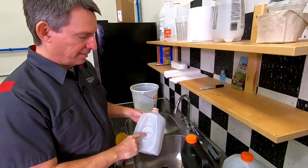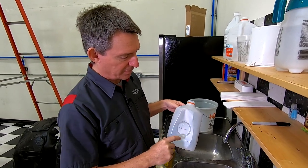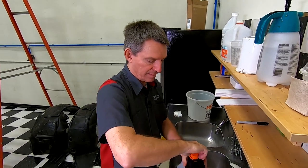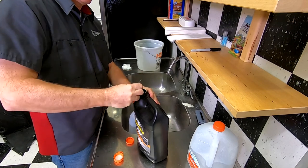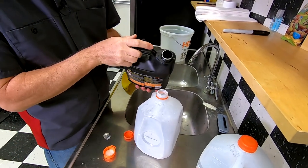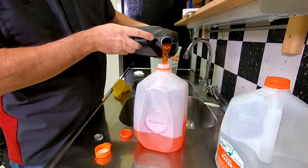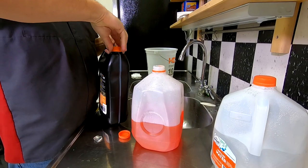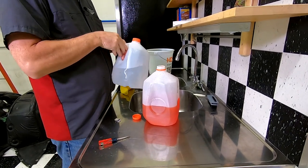I'm going to put the receiving bottle in the sink. I've worked out that since this holds four liters, that's the two-liter mark. So I'm going to fill it up halfway with concentrate and then top it off with distilled water. Let's open up our concentrate and break the seal. I'm going to try to do it without a funnel - so that's about two liters of the coolant. And now I'm going to add two liters of distilled water picked up at the local grocery store.